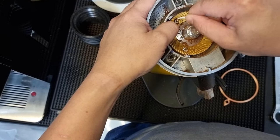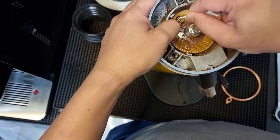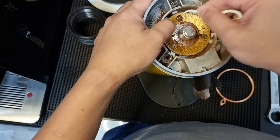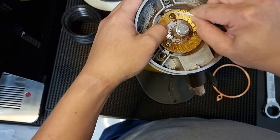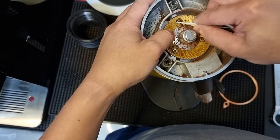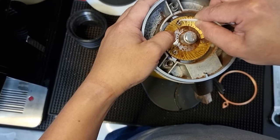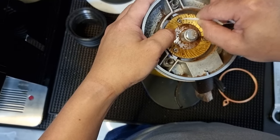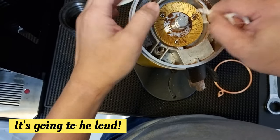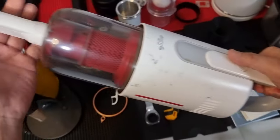You can see there's quite a bit of coffee ground stuck inside there. You can use a bamboo toothpick as well — that's fine. This curved one is particularly useful for removing coffee ground stuck in between. Since I'm doing a total cleanup, I'm going to remove the screw as well and try to restore it as much as possible back to the original condition. It's good to have a portable vacuum cleaner.